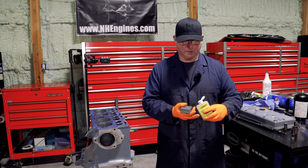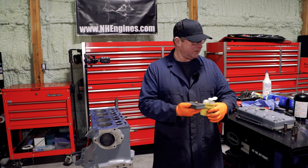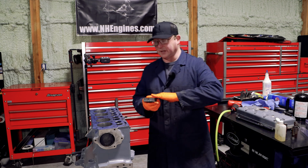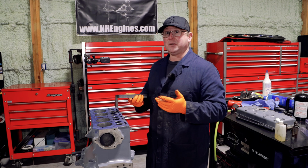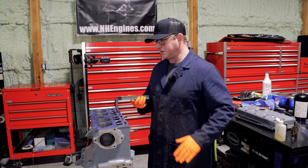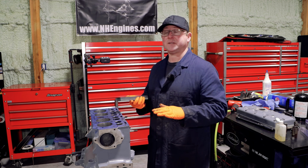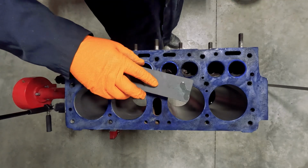I know you're thinking, well, how can this be accurate? You're doing it by hand, but when they used to make really high precision molds, they were all machined and then hand finished. And back in the day, the only way you could ever get anything truly accurate and flat was with hand finishing. So what we're doing is we're just taking off literally the dykem. We're taking off so little material here, but you need to run it in a figure of 8.